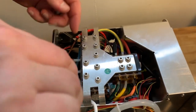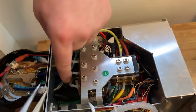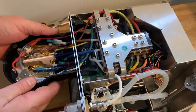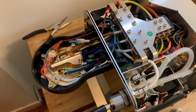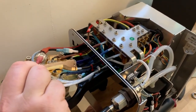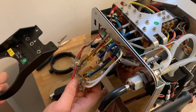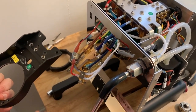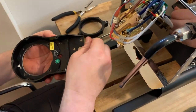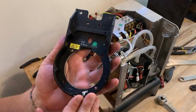The needle nose are helpful because the space is a bit tight. The most difficult bolt requires moving wires out of the way. There are locking washers inside the support. The next step is to simply lift the WPI out of the support with the bolts in it, hold the WPI up, and pull the support out of the machine. Now you can let the WPI hang down — just take care that it doesn't bounce off the front plate. Take out the three lock washers from inside because we're going to reuse those.